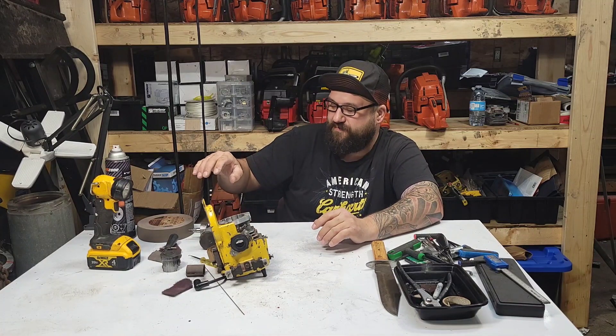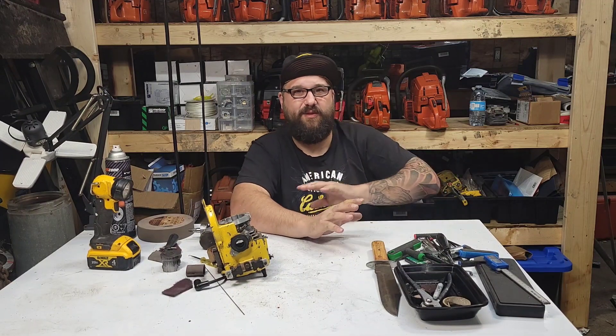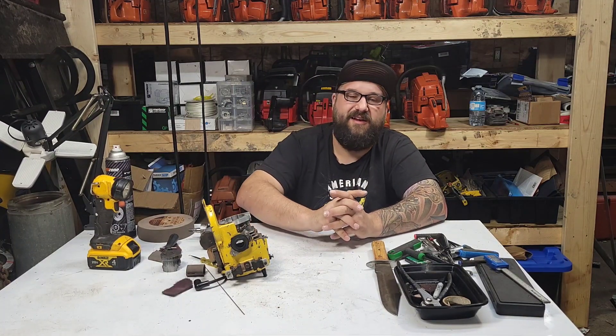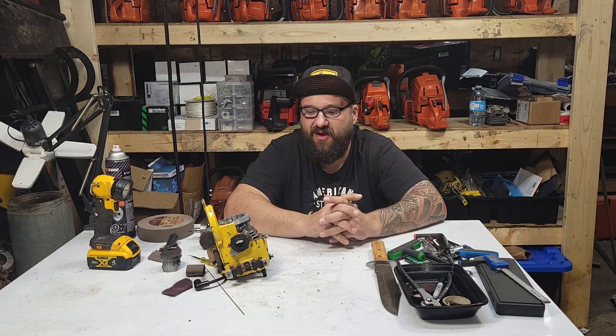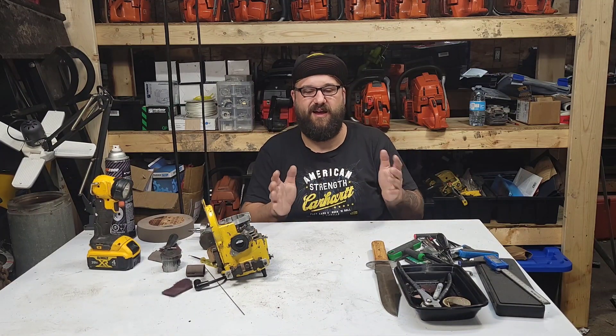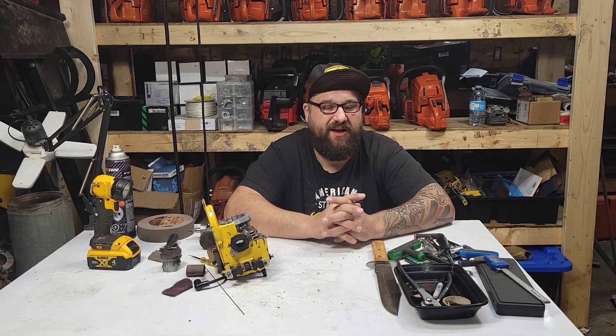With new plating there'd be no worry about it burning down again, so that could be nothing but a good thing. I boxed up Buckins 922 Homelite and mailed that off to him — happy to get that thing out into the world. A lot of time went into that saw, and I hope he likes it. I'd never ported one of those before, so that was a shot in the dark, and I think I succeeded. All the years of porting, studying, and keeping notes are definitely working — the more saws I port, the more data I have in my timing book.